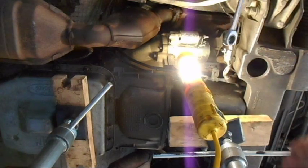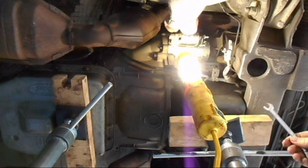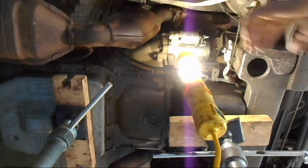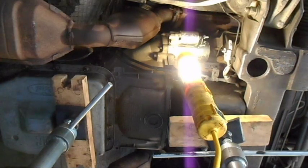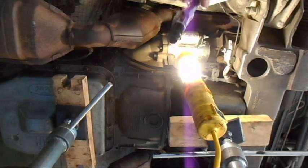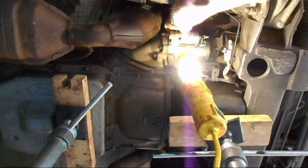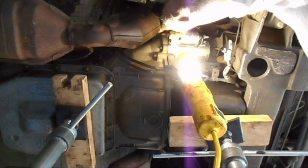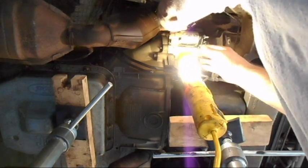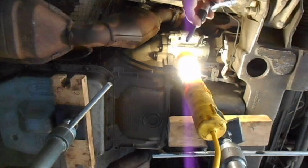So this is the type of wrench it is. It has a ratchet mechanism in it, and I'm able to actually get onto the little bolts here. The problem is the other bolt is so tight in there. I have to get a small extension to get it out. So now I have a short extension with a U-joint. Put that on there, and I'm going to try to spin it out. It's finger tight, but there's just no way to get your fingers on the head. It's actually a terrible place for a bolt. I don't know why they put it up there. It's very difficult to get this off. There you go. There's that bolt I wanted out right there.